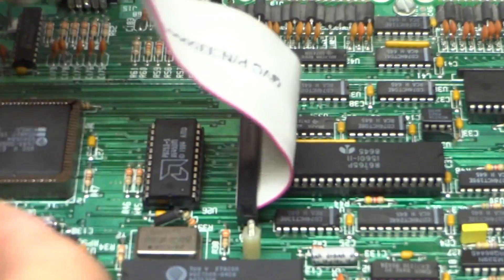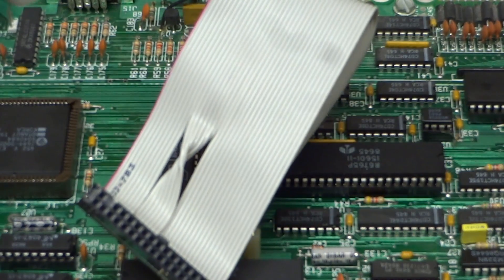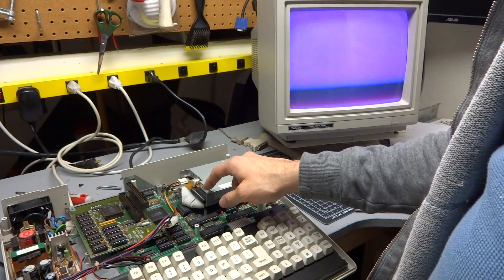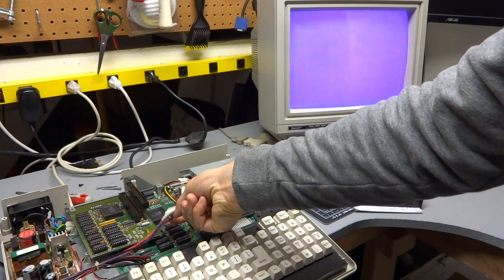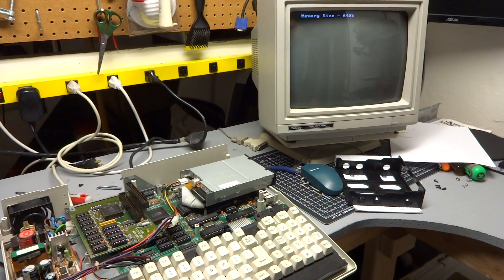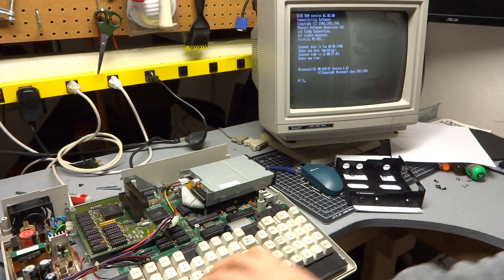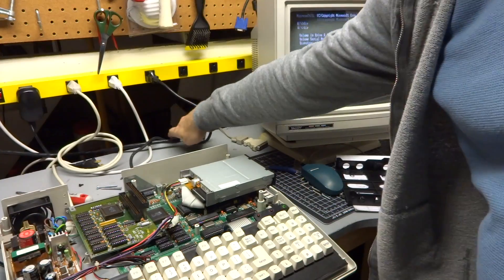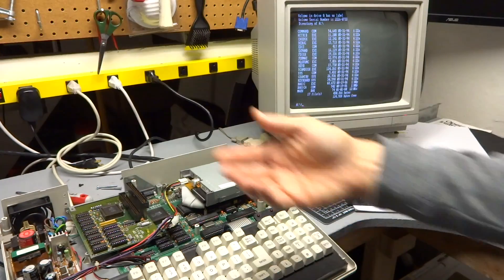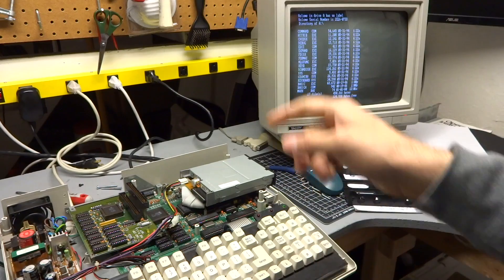And there it is — perfect. Now the only thing I have to do is some folding to get this cable to wrap around, but there should be room. I have the Tandy roughly assembled, using my modified cable which just swaps pins 10 and 12, and I have a power adapter on the floppy drive. I have a boot disk in here — the drive is seeking normally, and that's a good sign. DOS 6.22 working perfectly off this disk drive. I don't have the external drive connected here, but absolutely it works. This computer's BIOS supports dual 720K drives right out of the box, so you'll have no problem with this mod — you just have to fix the cable.